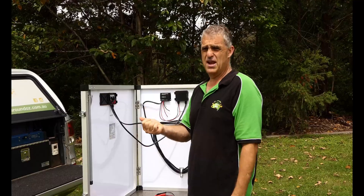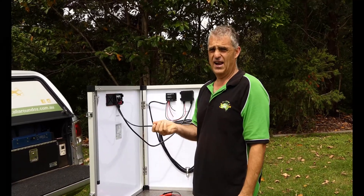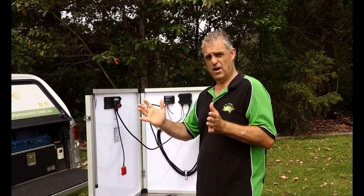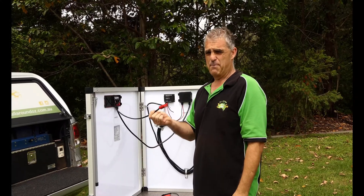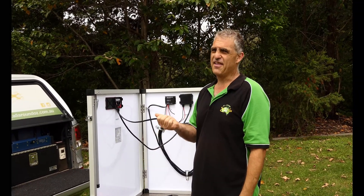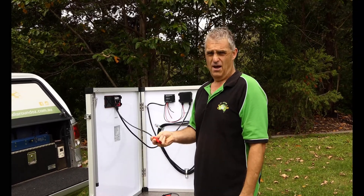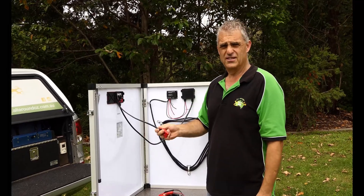Minimize voltage drop — you need to send as many volts as you can into your regulator and keep your regulator as close to the battery as you can. Our D250SA is this far from our main battery. The whole aim of the game is to get power back into your batteries so you can stay out there and do what you love doing for longer. Hope that makes sense. Any questions, leave them in the comments below. Thanks for watching. Safe travels.